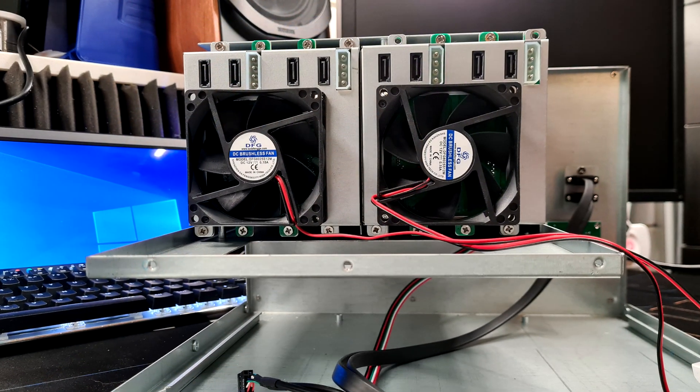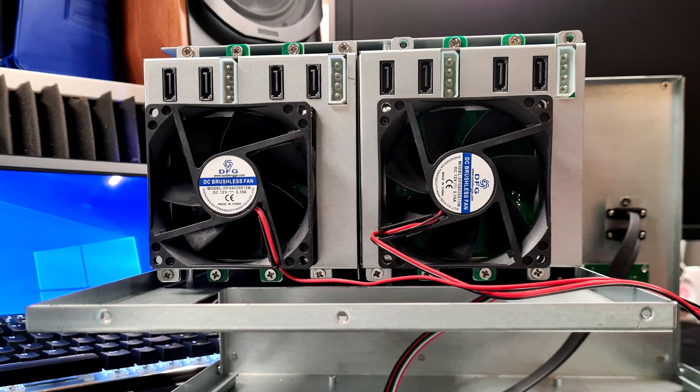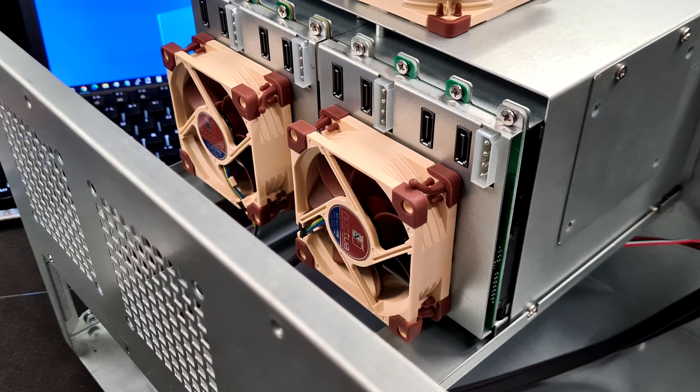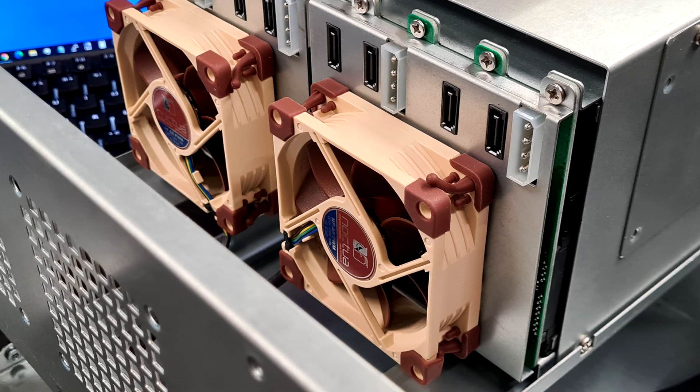There'll also be an article, but I'm not sure it'll be done when this video is released. So first thing that is new is the fan swap I did. The chassis comes with 4x80mm Molex connected fans, and I replaced all of those for Noctua models. Although the stock fans weren't horrible, they were certainly present, and with them being the Molex type, there was no real easy way to slow them down.